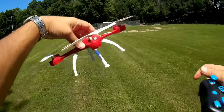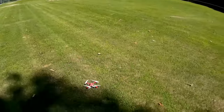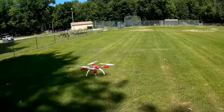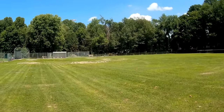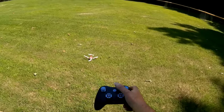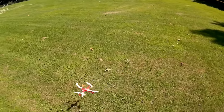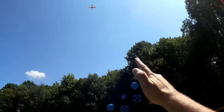Let's turn on the quadcopter with its on/off switch — and just a quick note, those lights are intense, some people might have problems with the bright rapid flashing. Let's put this into the air and see how it flies. I'm trimming it up — it's a very stable little quadcopter. I'm in beginner rate. This supposedly has a range of 100 meters, but let me demonstrate what happens if you turn off the transmitter. Counting off seconds — the lights are flashing and it descends and eventually stops.